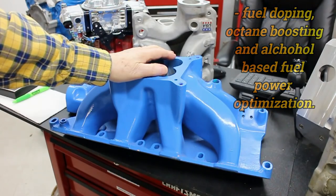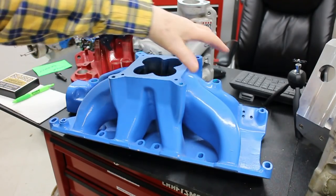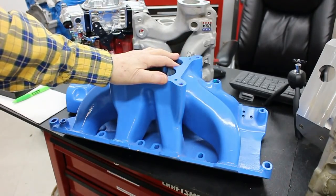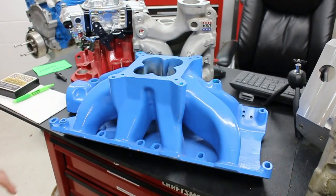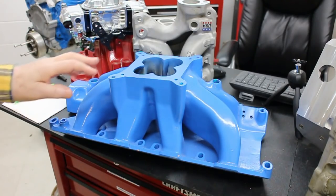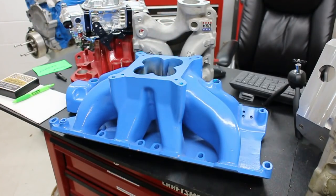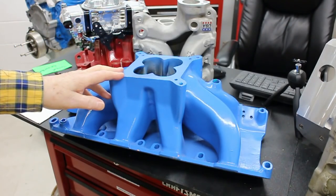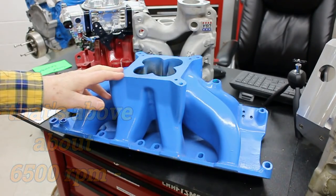This was designed by a friend of mine in Australia, Terry Parker. It's called a Funnel Web — strange name, but Funnel Web is the name of a deadly spider. I guess this is spider-like, and it's deadly. I had a hand, along with my friend Dr. Eyre Helgeson, in designing this. We advised Terry what and how to do things. Unfortunately, time delays meant that what he produced was actually about one or two steps shy of what we were recommending. In the form you can get this, it's about the best manifold for top-end power on the market, but it's not so good on torque.